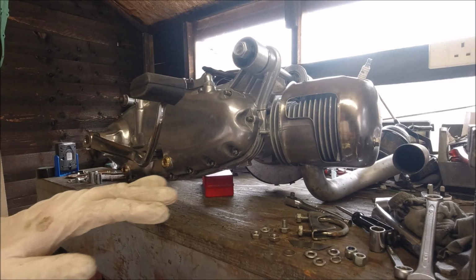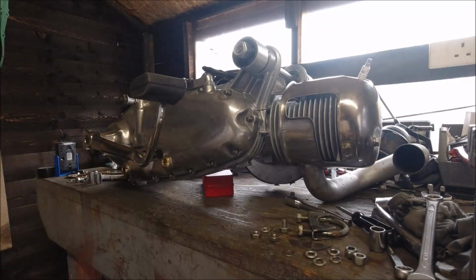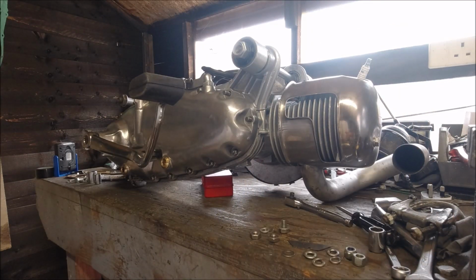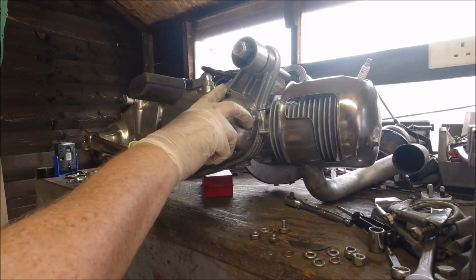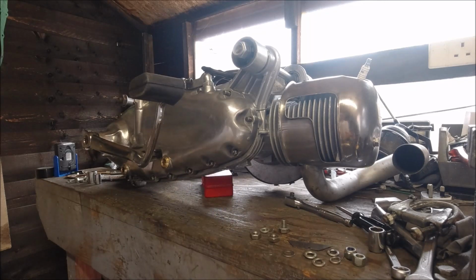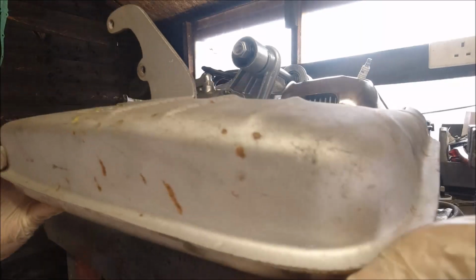Right, now we've cleaned up the downpipe. I've cleaned up the exhaust itself. I'm trying to get it without knocking the camera, but that might be a little bit mission impossible. And what we actually need is some gun gum, either there or inside there on the mating edge. We've got the U-clamp, so that's not actually that bad to clamp in after we've got the exhaust in position. But we've got 2 bolts or 2 nuts going on there. We've got a bolt in underneath here, which is that bracket there, and then we've got one on the end, which is the longer one, and it goes on like that.